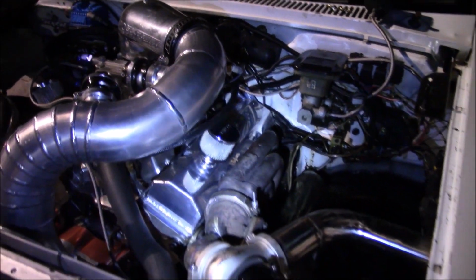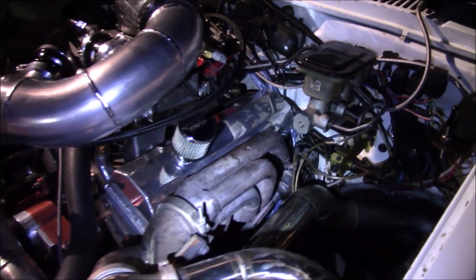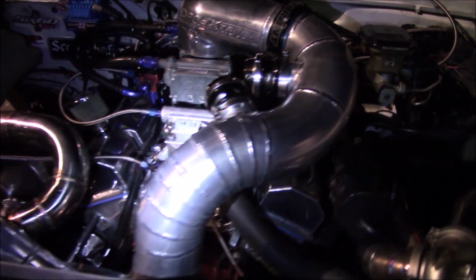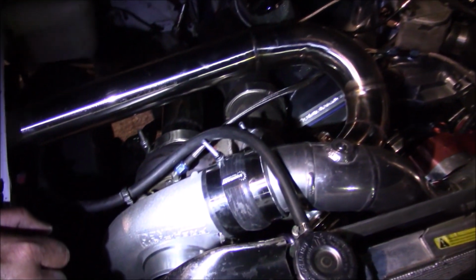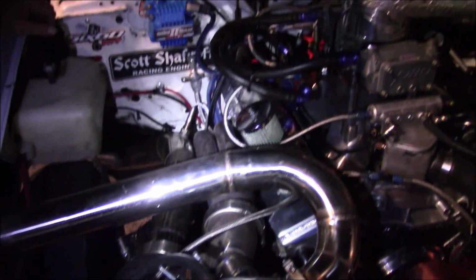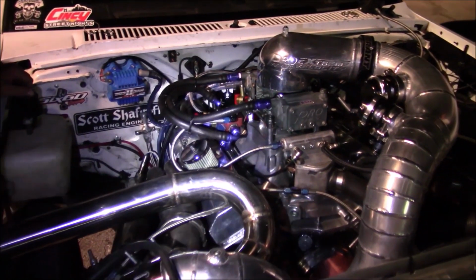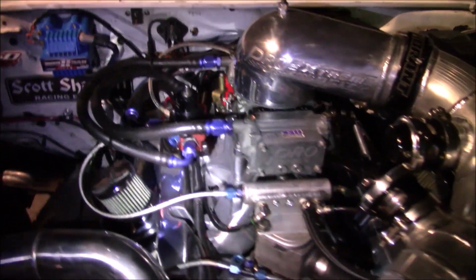Did you tell him what you told me about those wastegates? Go tell him, because if I tell him, he won't listen. Can I record this? Yes, I wish you would. My point was just that with a 60mm gate with that much pressure, it'll take a lot of dome pressure. So I won't be surprised if it needs more than it used to. Doesn't mean anything's wrong, it's just the nature of that arrangement. The big gates are hard to keep shut, so they take a lot of pressure up top.